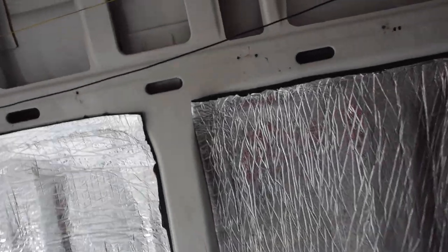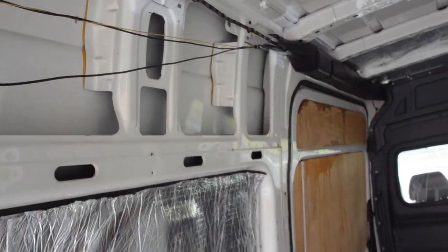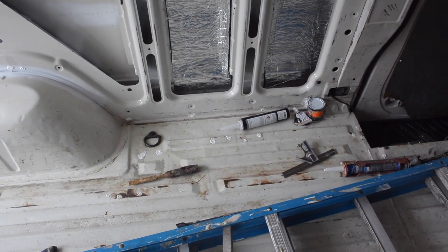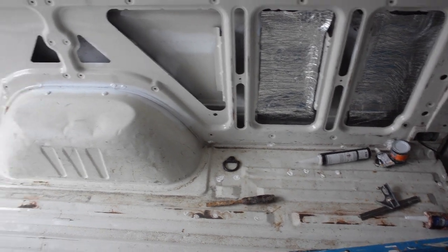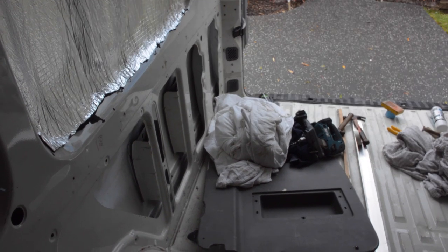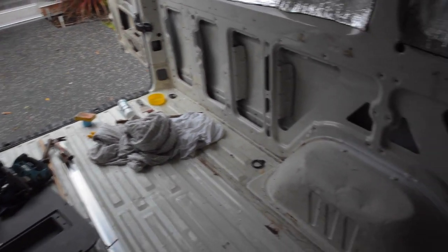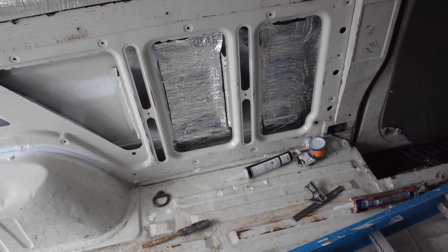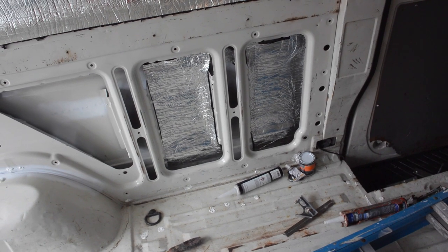I might even be able to run the solar cables down through that side — beautiful. I think that's a better idea. I can have my charger, inverter, everything in that box. That's going to be a seat — just going to be nice. In the back there's going to be gas bottles, gas storage, and a gas heater. If you put batteries there it's just a bit too much. Batteries here are nice — at least I can lift up and have a look. It's going to have an automatic changeover switch from the inverter to shore power, which I've done before and it works really well.